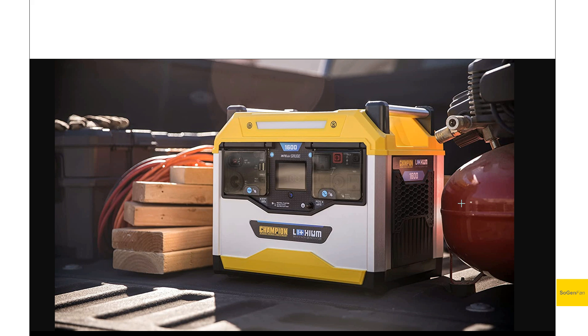The silver sections I believe are aluminum — similar to what Goal Zero uses. Aluminum has very good heat-transferring properties, so as the inside of the unit heats up, the aluminum transfers that heat to the surrounding environment, making the unit less dependent on cooling fans and keeping it cooler overall. This is especially important because these units use NMC batteries, which are more affected by heat than LFP batteries. Heat is basically what leads to NMC batteries having fewer life cycles, so keeping them cool can significantly extend their lifetime.